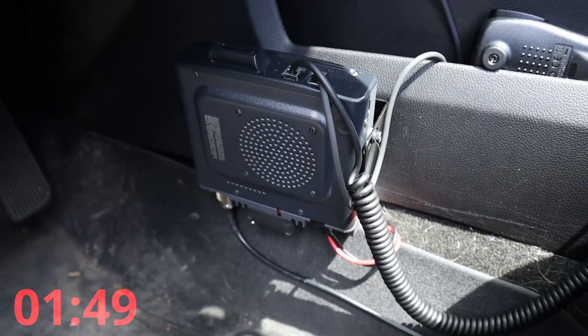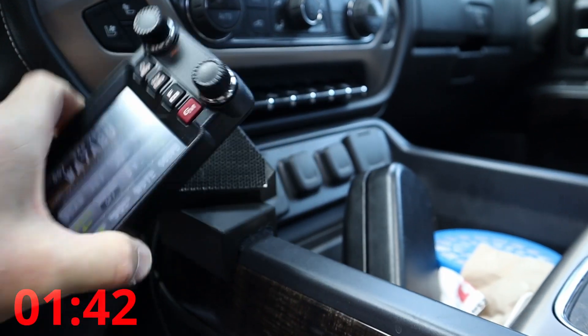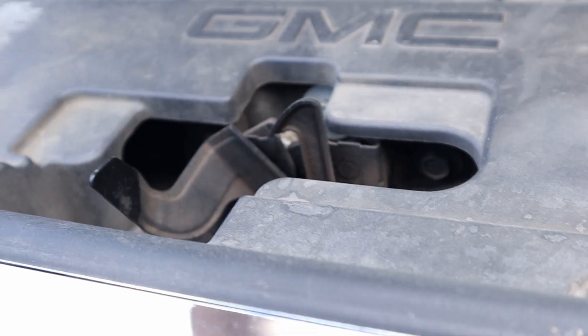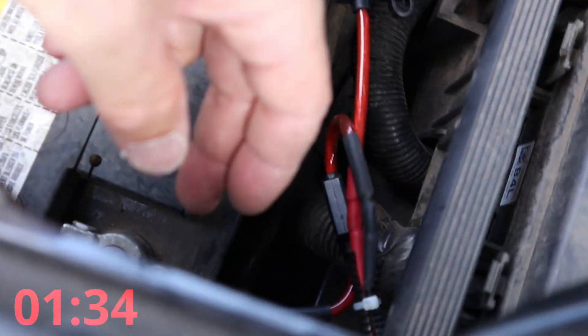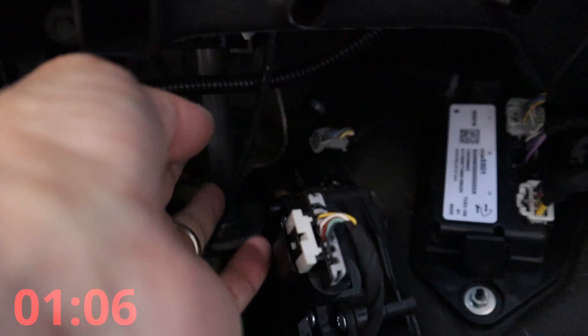The install was relatively easy. A couple of caveats for me: I didn't want to drill any holes into the console and tried to keep it as flexible and removable as possible. The first thing I did was install the power. After searching the internet, I found a great little rubber nipple designed for accessory wires — a universal rubber boot through the firewall. After making a slight hole in that nipple piece, I used an old Baofeng antenna, wrapped some tape around each of the wires individually, and ran them through the rubber boot. After getting those secure and all the way through, I wrapped them in a wire organizer and routed them through the console as needed.